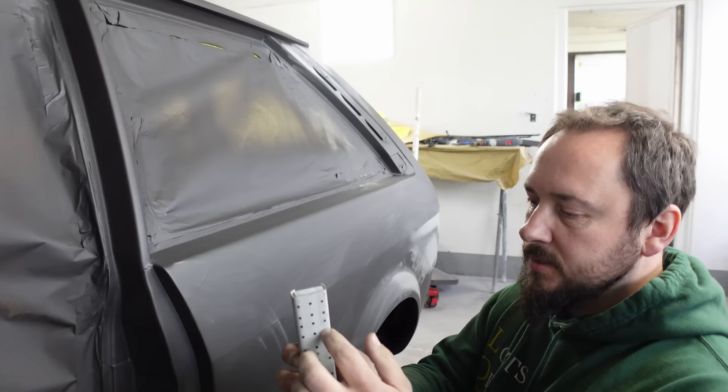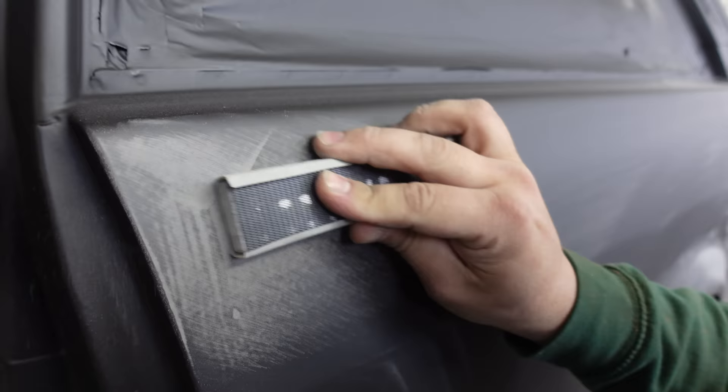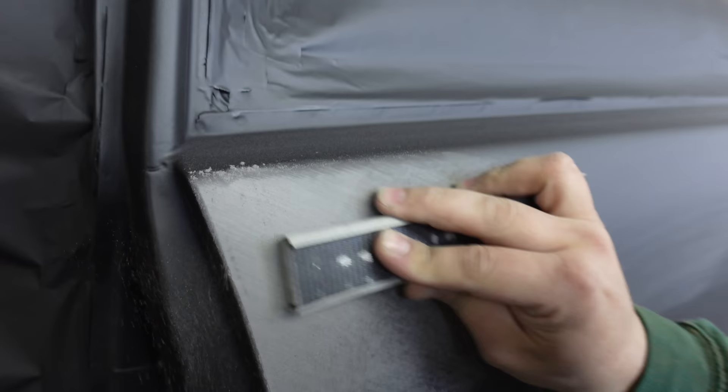Again, a nice hard block. Because I'm using the non-velcro side of this bulletproof block it is extra flat - it's not going to give any give at all. So I'm just going to have a lot of confidence in the tool, in the block, and go for it. You're just smoothing out that fine spot of the run into the flat of the panel. And you see your colour has gone all uniformly done - that is it. Run, it's gone.